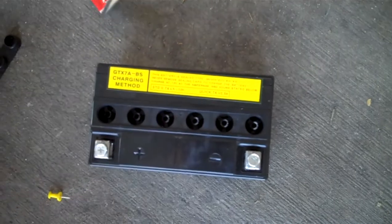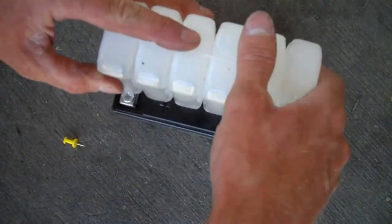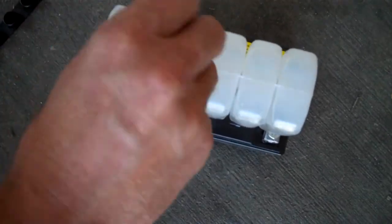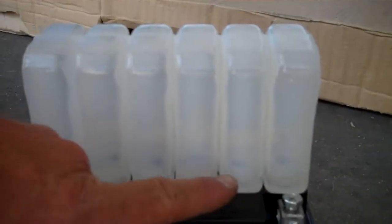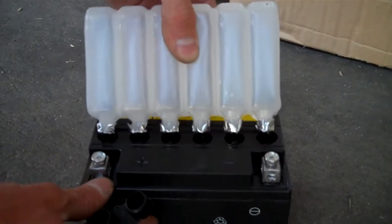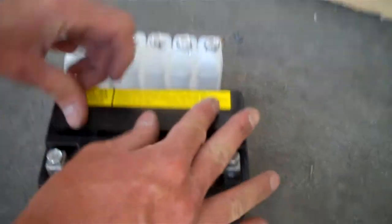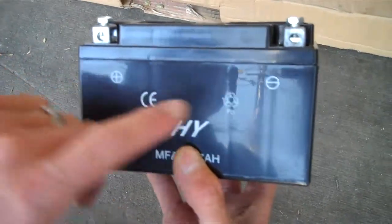Remove the battery cover. You'll notice you get acid with the battery — they're sealed. Place them on here, get it positioned correctly, just tap it. Then you'll have a safety pin or a tack — just poke holes in the top of the acid bottle. Be sure not to get acid in your eyes or on your skin. Notice the acid draining down into the battery. Once it's drained, let it set for at least two hours before charging it. You'll need a trickle charger — a slow two-amp charger. Remove the acid containers once completely drained. The battery will come with a little cover that pops into the top. Now your battery is ready to be charged. Make sure you put the red on the positive and the black on the negative to charge it on a two-amp charging system.